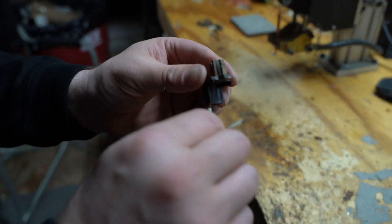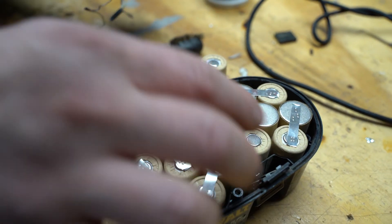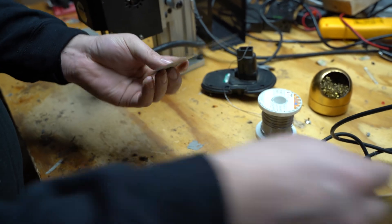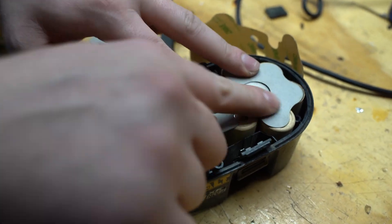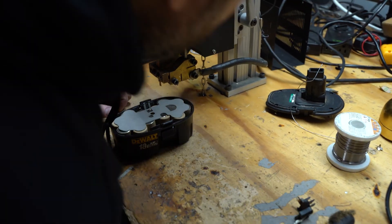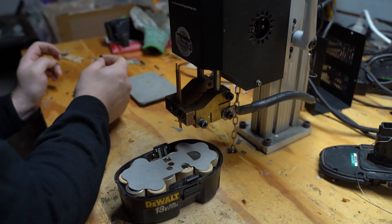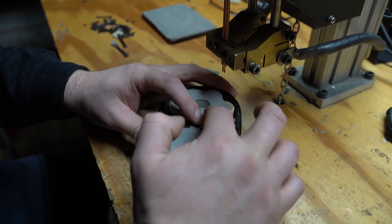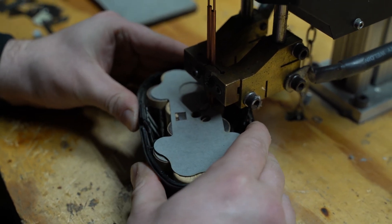Now that I got this top piece, I'm going to take this wire brush and just give it a little bit of cleaning — you can tell these are starting to corrode. Down here a little bit on this guy that's going to get connected to the battery. This will make it easier to get any glue or old crud off so that when I'm soldering the new connection it'll solder a lot quicker. Now I'm going to show you how to connect this part and what to do with these two cells that are left. We're going to take our little 3M water seal and throw that right on there. I don't like to solder right to a battery so I always put a piece of nickel strip — this gives me the ability to wrap the nickel strip around the connecting piece so I can make a better connection with the solder later on.